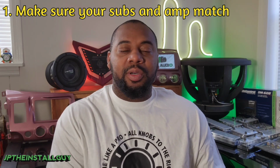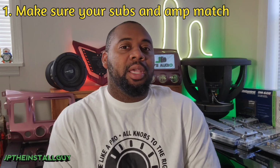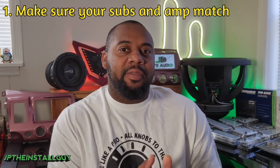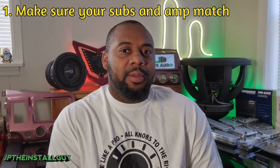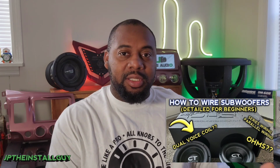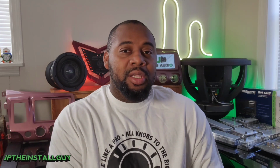When you look at your 212s, if you have a 1200 watt amp, and that's 1200 watts RMS, I advise that you have at least 600 watt RMS handling power for each one of those subs. Now, you also need to know how you have it wired. If you have two dual 4s, they can be wired down to a 1 ohm load. If you have two dual 2s, they can be wired to a 2 ohm load. So you need to make sure that at whatever ohm load you have it wired down to, that amp is going to provide the right amount of RMS power to those subs.